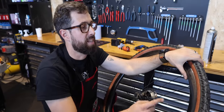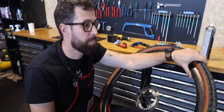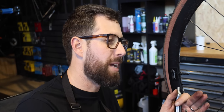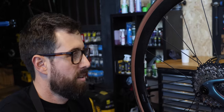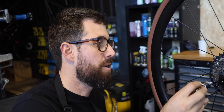On a tubeless tire, if you've had a cut and successfully patched it, ride it for a bit. If the cut stays sealed there's no need to replace your tire — it will hold for a really long time. As with the rest of these tips, these are worst-case scenarios. If you've bent your rear mech hanger — you can see from behind the mech is completely skew — and you just need it a bit more straight to get home, here's a hack. Take your rear mech off; it's usually a 5mm allen key, and on some bikes a T25 Torx.